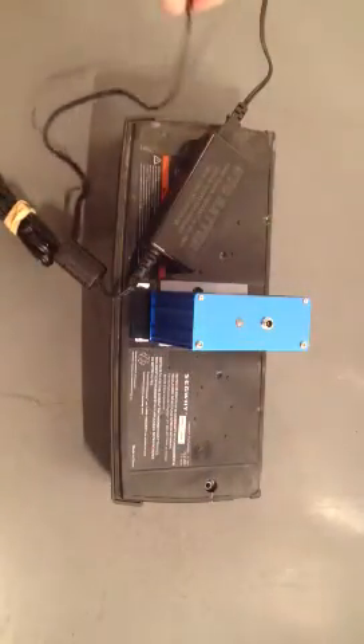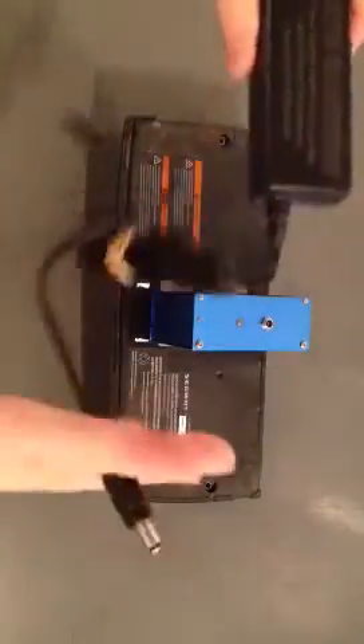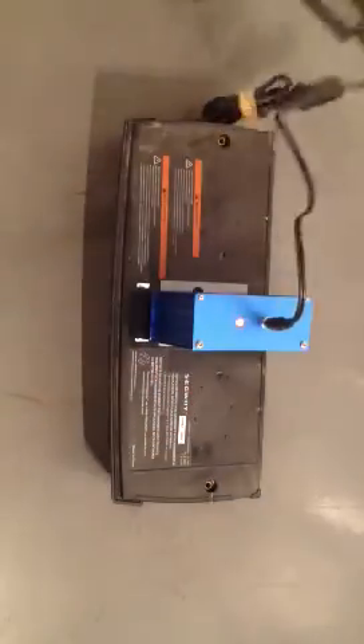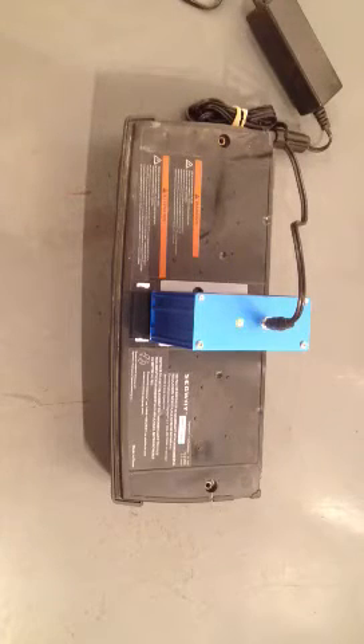At this point we'll just take the laptop power supply that comes with it. You'll see it's MTO battery branded and has a special plug. We'll plug directly into the jack there, and the unit goes through a diagnostic sequence where it's evaluating the battery and determining what needs done. Once the light starts blinking slow green, the reconditioning process has begun.